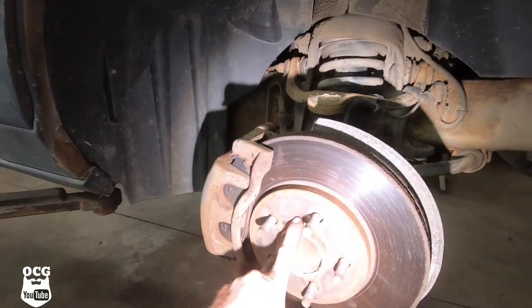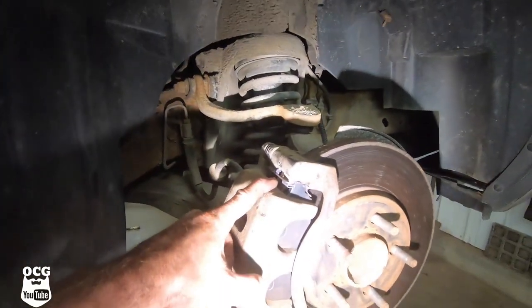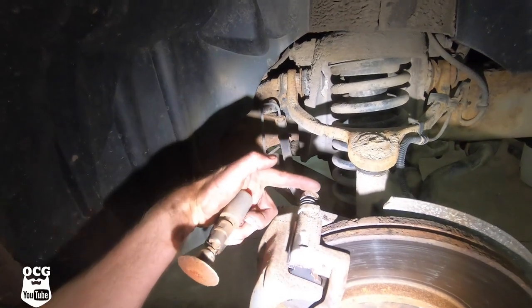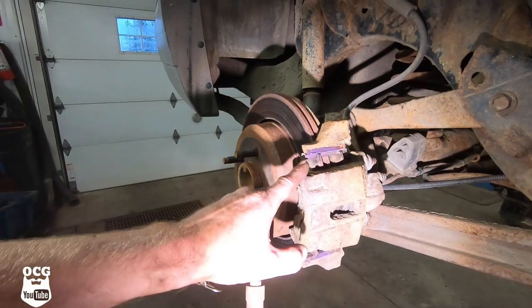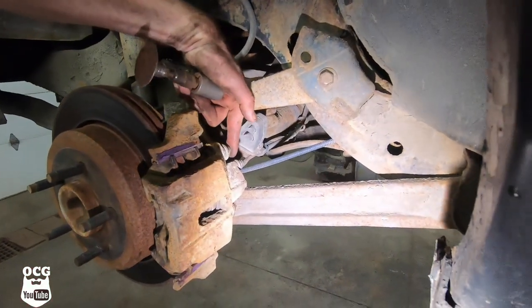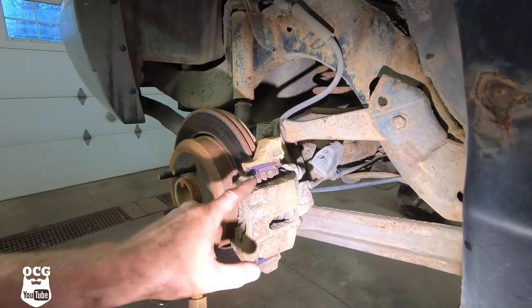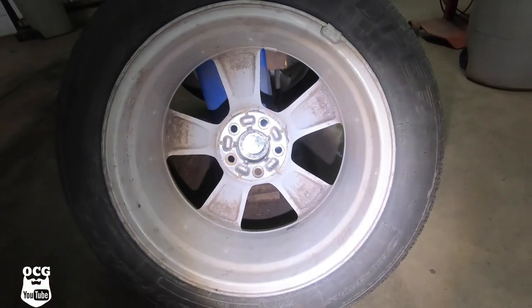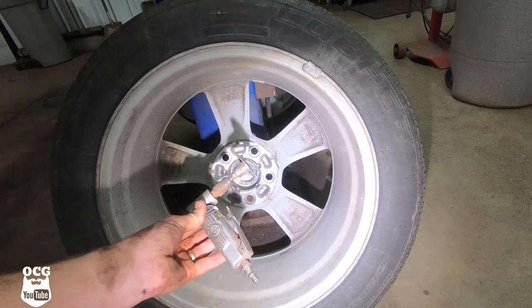The Kia is on the lot and ready for sale. Our brakes are now serviced all the way around and we're getting ready to put the wheels back on. Here's what we did: the rotor mating surface is cleaned up, new stainless steel clips are installed and lubricated, brand new pads are in, and the caliper pins have been pulled out and re-lubed with brake lube. Around back, the stainless steel clips on the brake bracket are done, the rear pins are lubed, and the sides of the pads are cleaned up. We also cleaned the mating surface of the rotors and the rims using right-angle air grinders with a flap disc.